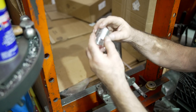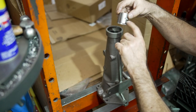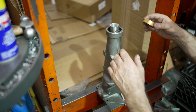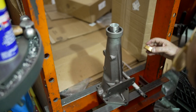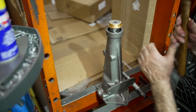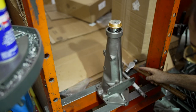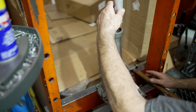When installing the bushing, make sure you lube it up — I've used some WD-40 on it. You want to make sure the slot of the bushing is facing the return oil slot on the bottom of the tail housing. I'll just tap this in a little bit to seat it, then I'm going to use my trusty press and press the bushing home.